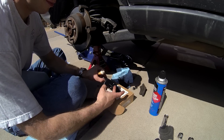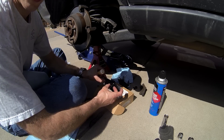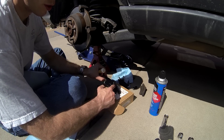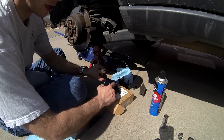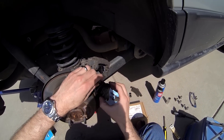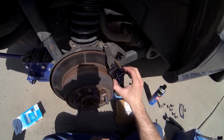You can tell the outside brake pad because the backing has no bracket that attaches to the caliper — it slides freely on its own. So this will be the outside brake pad, and we're going to apply some anti-squeal compound on the back of that, then install the new outer brake pad by sliding it into the respective grooves of the caliper mounting bracket.